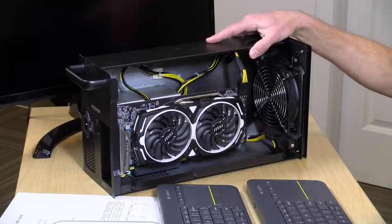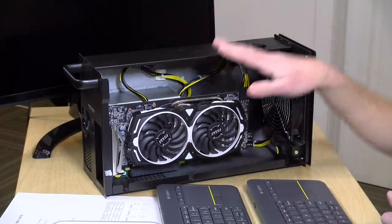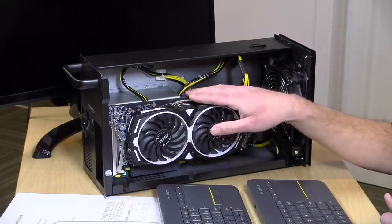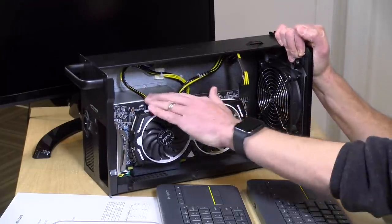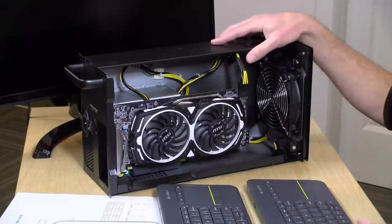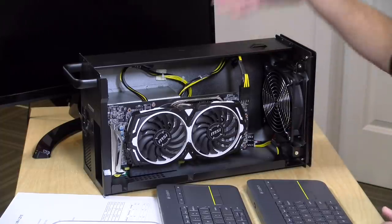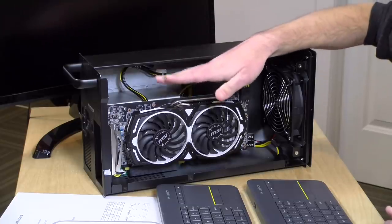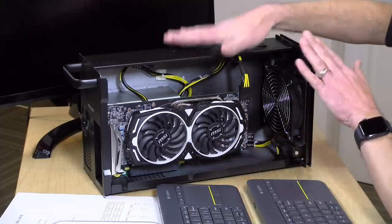This is an eGPU. We reviewed this about a year ago — it's called the Akitio Node. It's a box with a slot for a desktop GPU card. In this case we're using an AMD-based card, specifically an MSI RX 580, which is compatible with the Mac. One important thing to look out for is that Apple doesn't support Nvidia cards, so you have to go with a compatible AMD card. I'll put a link below to Apple's support page listing which cards work. I like this enclosure because it's no-frills, about $200, and works great on both PC and Mac. The RX 580 card also cost about $200, so about $400 total for the case and card.